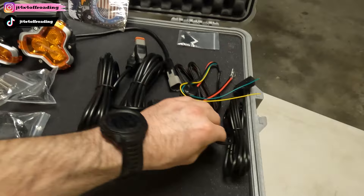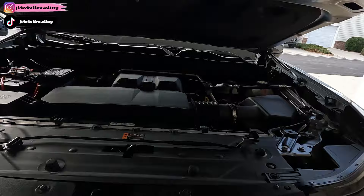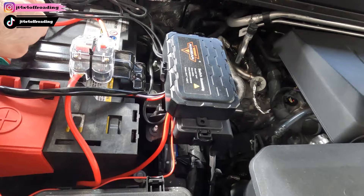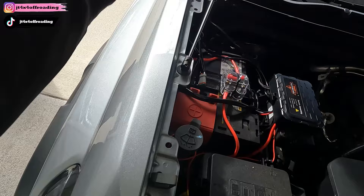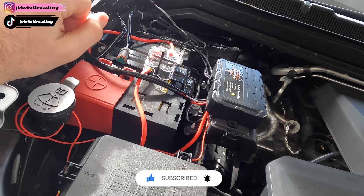I'm going to do a basic installation and show you how to do it with just positive and negative terminals. So under the hood, it's pretty simple — I already have a switch panel here. What I'm going to do is hook the lights up to the positive and negative battery terminals, run the wire inside my window so I can toggle it and see how the lights function. Later on I'll splice the wire up into my panel. We're going to pop this off, plug all these wires in, and get everything situated.